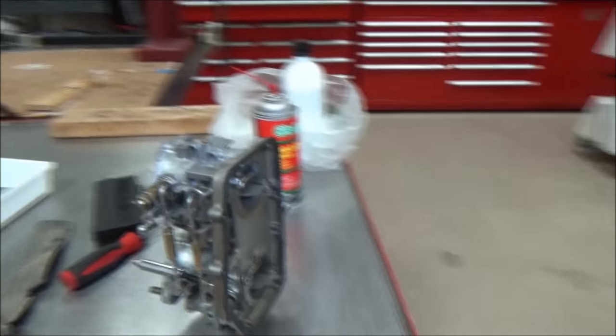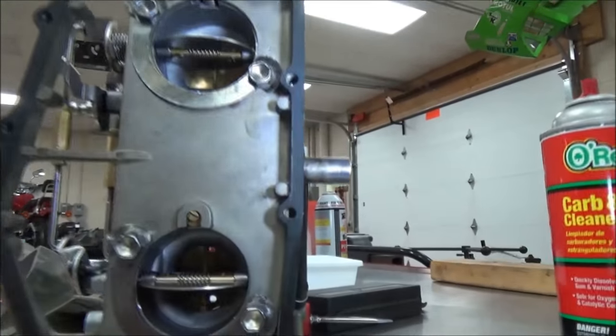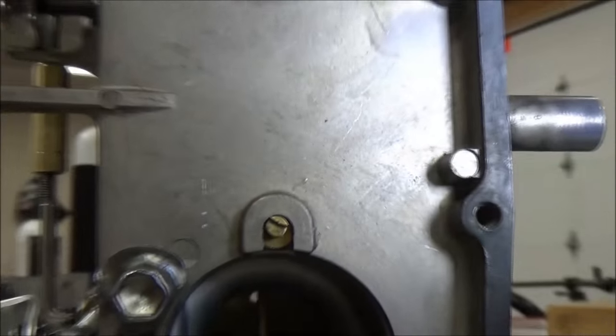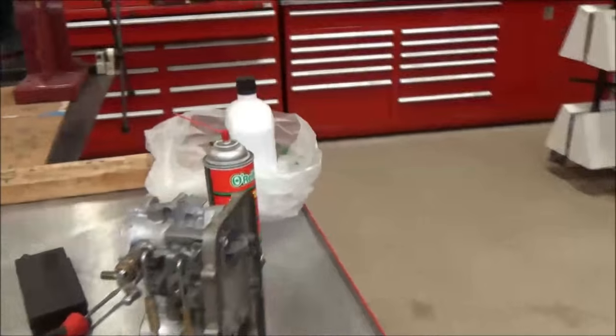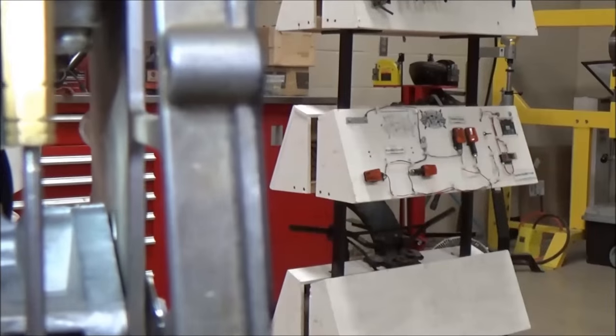I'm going to show you our little problem here. You can see this airbox assembly on these carbs. When I was working on it, a couple things came to me: first I could see that crack, and the other thing is I looked at my notes from disassembly — these screws, which are supposed to be set about one and five-eighths to two and a half turns, were only at about a quarter turn.